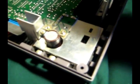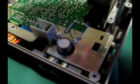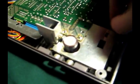One more thing I forgot. You do have to take these 2 screws out that hold in the kind of power audio video board. It's gonna be kind of hard with one hand. There's just 1, 2 right here, because this motherboard's actually physically attached, soldered to this little shielded box. I believe these are still the same size as the rest of them, so nothing complicated there.